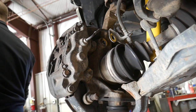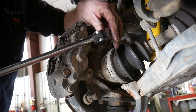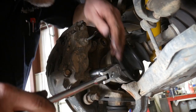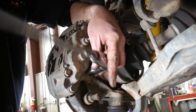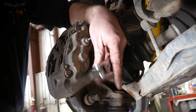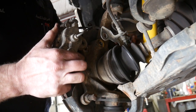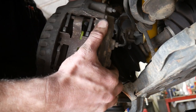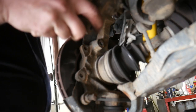Next, we need to take the brake caliper loose. If you choose to remove the brake line, you will have to bleed the brakes afterwards. But since I unbolted that bracket first, we have the flexibility to remove the caliper and position it off to the side without damaging that steel line. These two bolts are a 17mm head, and they can be quite tight, especially if someone has used Loctite on them in the past. Since we don't want to hang this down on the brake hose or the steel line, I'm going to stick this flexible hanger in there and hang it up on the control arm.